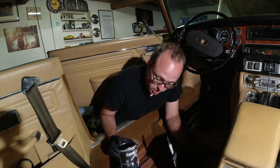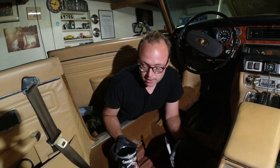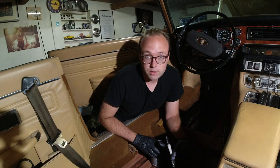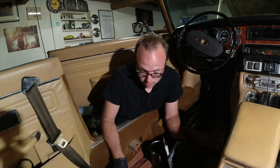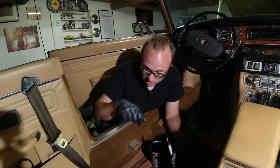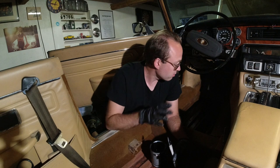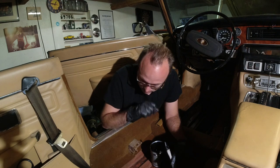This stuff is great - I really like this paint, Combi-Color by Rustoleum. You can get it in lots of different colors and you can blend it yourself. One can gives you a very dark green that's really close to mid-70s Jaguar British Racing Green if you add a little black. It's paint over rust, which is great - I've used rust converters and I've never had rust come back where I've painted it, especially on floor pans.